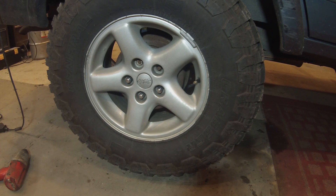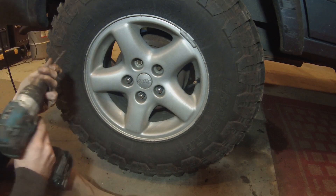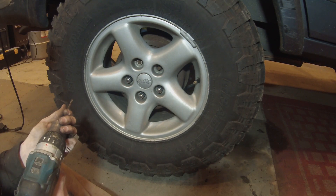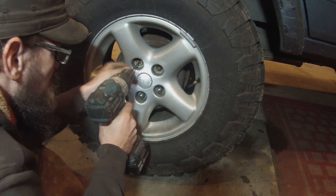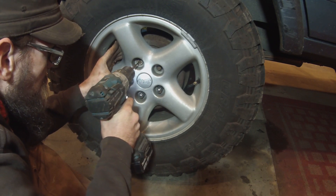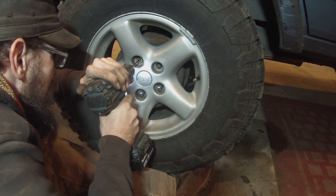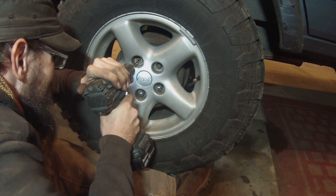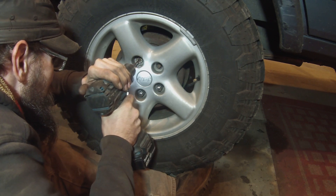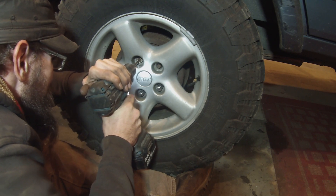It's really not a big deal when you have a broken lug nut or even a broken stud. You just hammer the stud out after the wheel's off, take the brakes apart and change the stud. 90% of the work on a car anybody can do. I don't like drilling at slow speed — I don't go full throttle second gear, but I go a little bit. First gear is way too much torque and you'll snap the bit. I'm doing my pilot bit.